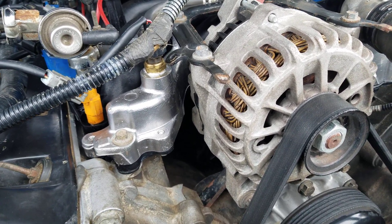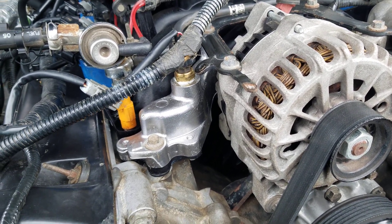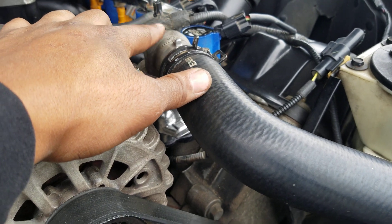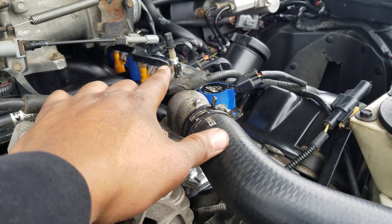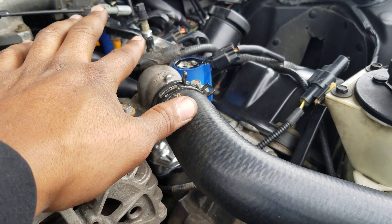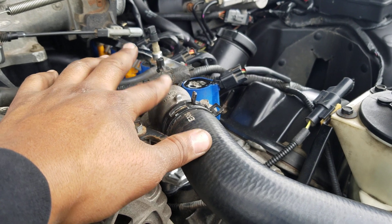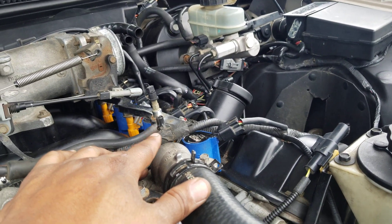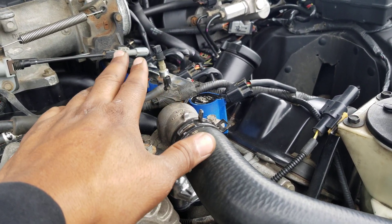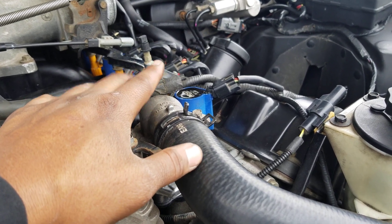Now, a couple of things with this: there's a write-up on it if you buy from ADTR. They say you have to get a certain thermostat housing for it to work. I ordered the one they suggested and it didn't work. But apparently mine bolted in fine, so that's one issue you might have. They say there's a part number — RT 44 something — that you need for this particular manifold, but when the guy installed it, it pointed the wrong way. I was able to use the one that came on the 98, the original one.